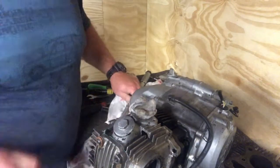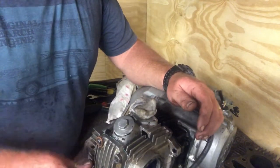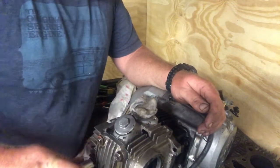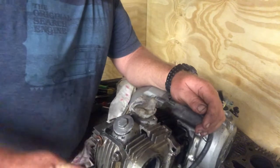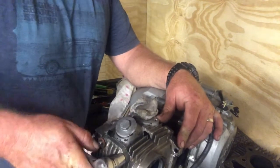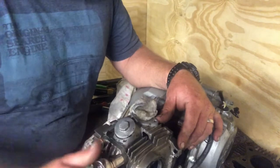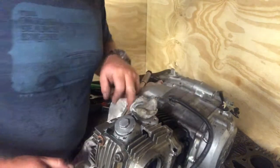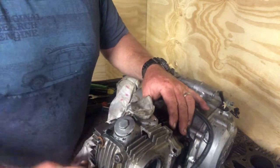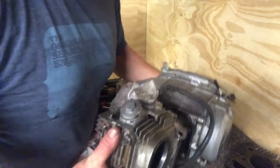What I do is gently take it up with a 14mm socket. If I'm getting any resistance or pressure I'll stop and check it out, also checking everything as I go. You can feel it just sort of going easily now — it's lined up on all its dowels and bits. You can see there's no pinches, no folds in either of the gaskets, and it's tightened up easy. So they haven't got their washers yet — make sure we take them off and put them on.